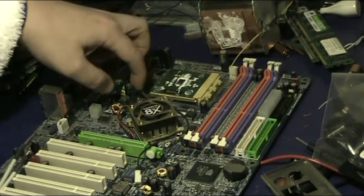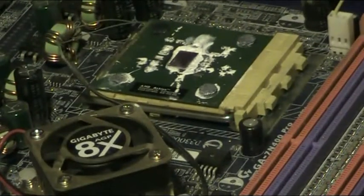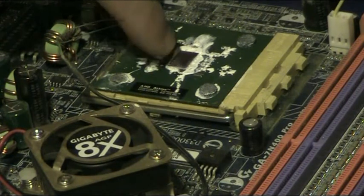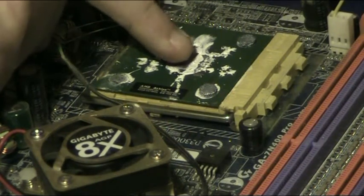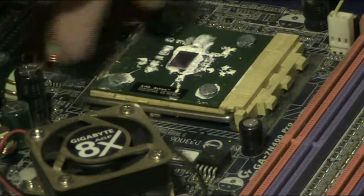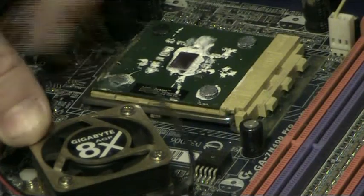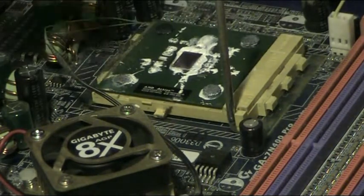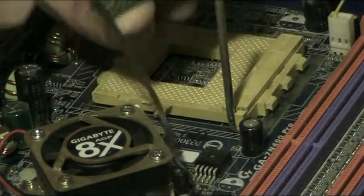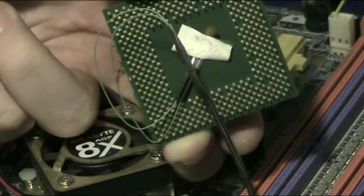Now the processor itself is typically small. These use what we call zero insertion force sockets. This is the chip that's on there — it's really small. You can see it in relation to my index fingernail; this one is about the size of my little finger fingernail. Zero insertion force sockets allow us to put chips in without the risk of bending all the minuscule pins on the other side. So I'm going to lift the lever up, that releases the pressure, and I can just lift the processor out. You can see there's massive numbers of pins on the back — that's the number of pins needed to make contact with the board.